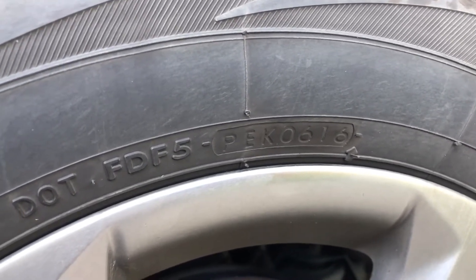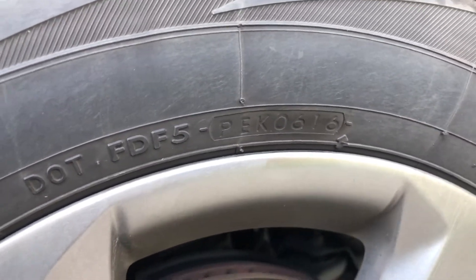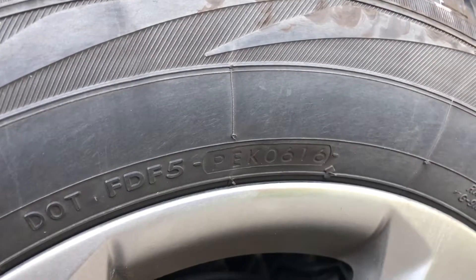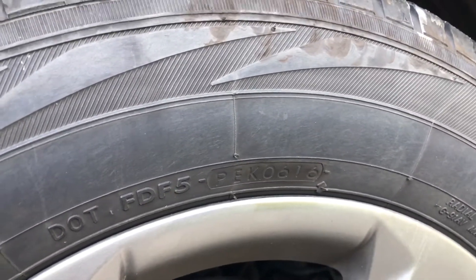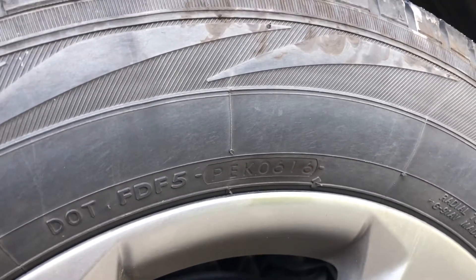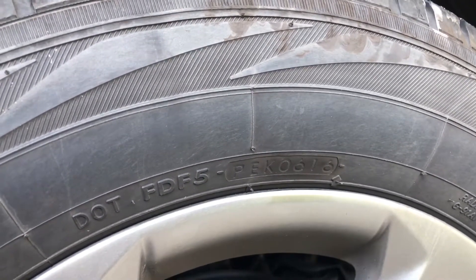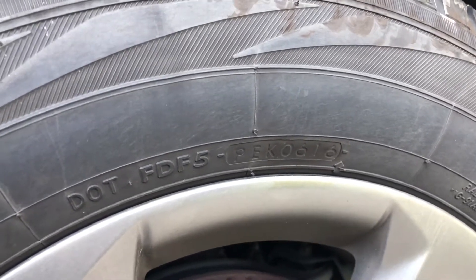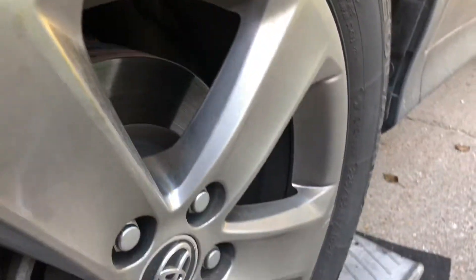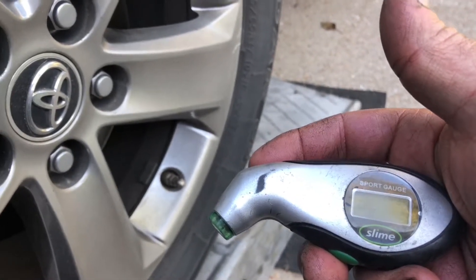For the most part, when your tire gets around six years old, you really need to be looking at getting another set of tires. I know you're going to say the tread depth is really good and the tires look great — that's fine, but over time the tire releases petroleum and the construction of the tire begins to degrade. For your safety, give that serious consideration. Tires break down over time. Another important thing: keep a tire pressure gauge in the door pocket of your vehicle.